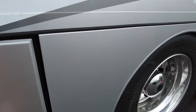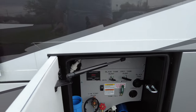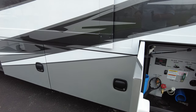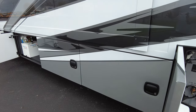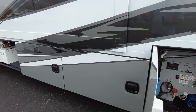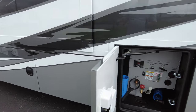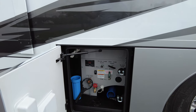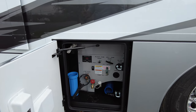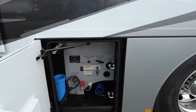When I do a walk around customer delivery, they last four to eight hours depending on your experience level. What I like to do personally is get my black tank to about 50 percent, and when I know I'm going to need to dump based on family usage, I'll close up the gray tank — if I'm hooked up to city sewer — and let the gray tank fill up quite a bit. Then I dump the black tank first, and dump the gray behind it because all that gray water will flush the stinky out of that hose. It makes it a much cleaner process when you go to do all your waste dumping.